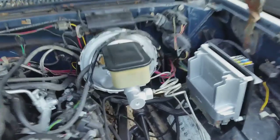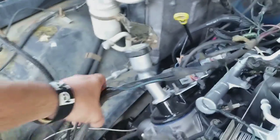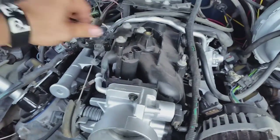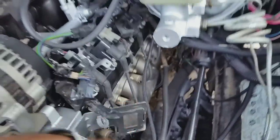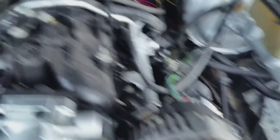That big bundle is what's going to control your starter and all the power that goes to your ignition. The other wires are your headlights, taillights, things like that. That group of wires there is what we need. You shouldn't need the alternator wire because the LS has the alternator wire on it — it'll go straight to your alternator and battery cable. It's already wired into your harness; there's your plug for the alternator. So that wire, I know we will be removing.